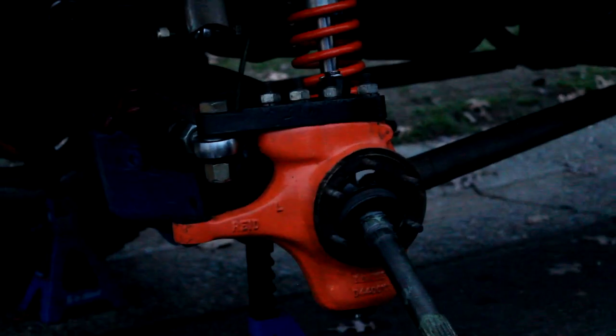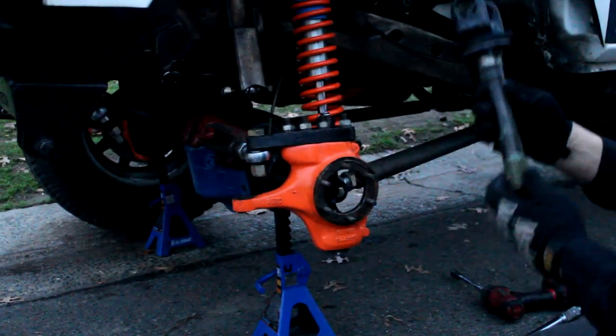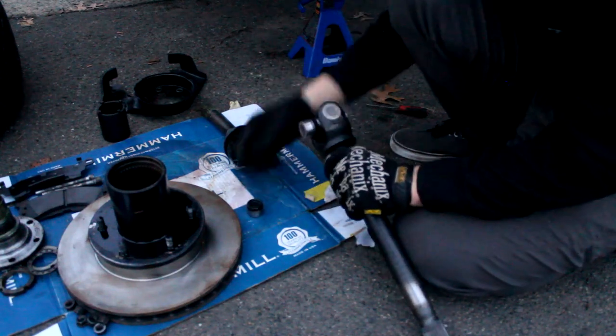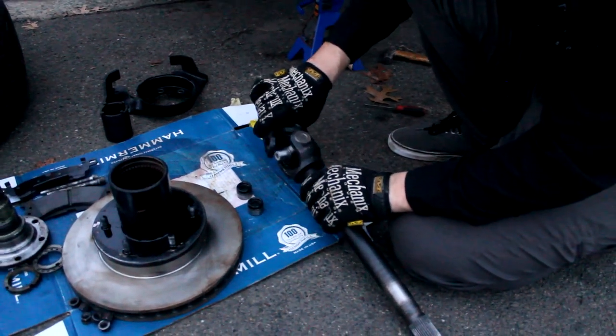She's still clean and not rusty — the rain didn't get to her too bad. Okay, fun part. Get this greasy bastard out of there. Try not to get too much gear oil everywhere and start to put the u-joint in. To start with, we will take the bearing cups off — just gently, without getting everything nasty and dirty. Slot the bearing cap on, get it started, give it a little love tap. Same thing on the other side.